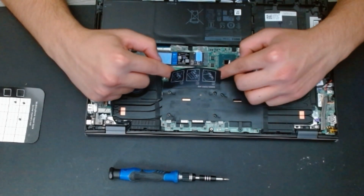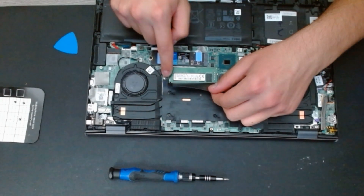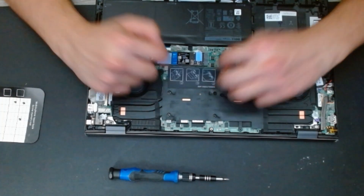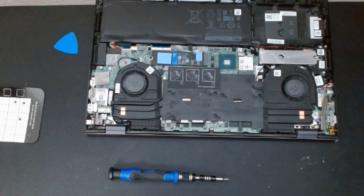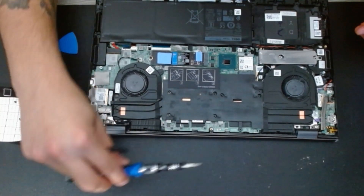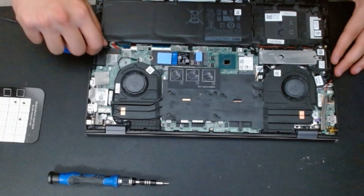What we are going to do is pull from both sides — these holders, these arms, pull from both sides. But before you do that, you always want to discharge the battery and disconnect the battery first. I'll open my kit again. Try not to touch anything with something that is magnetic or metal — I have a plastic tool here to disconnect the battery.